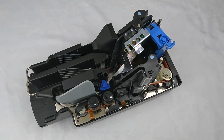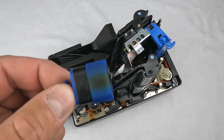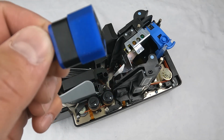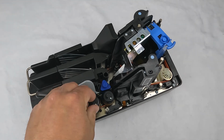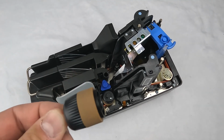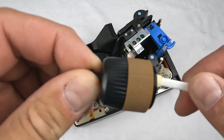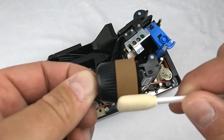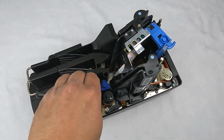Repeated misfeeds or double feeds may be caused by a worn separator. The triangular separator piece may be lifted straight up and rotated to a fresh side or replaced entirely. The main feed rollers, which can be identified by their brown color, can also be lifted straight off and cleaned or replaced. Both the feed rollers and the separator typically wear out only after extremely prolonged use.